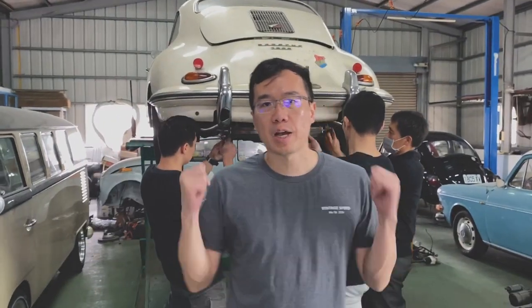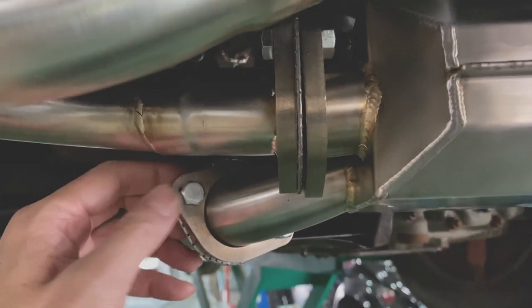So this is how to install the Sebring. If you replace the heater box with a J-pipe, put the J-pipe first. Then you put number two and number four header pipe, then slip in the heater box or J-pipe connecting pipe, then put the muffler connecting all the pipes. Make sure all bolts and nuts are hand tight first. Then we start to adjust the position of the tail pipe — we'll show you later. Everything must be hand tight first.